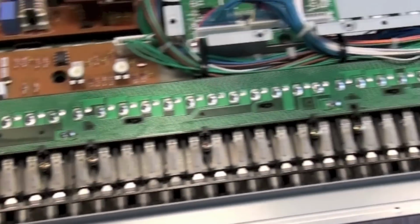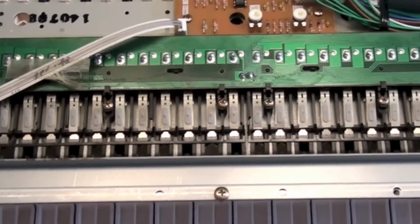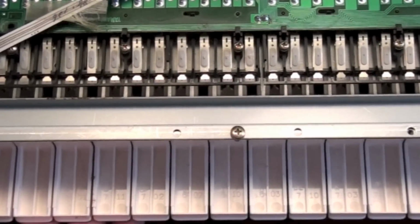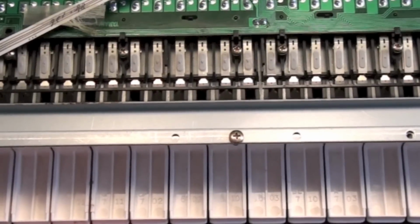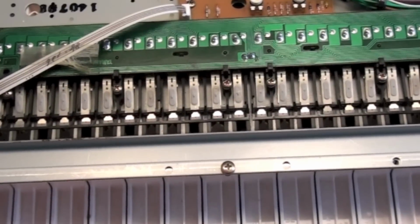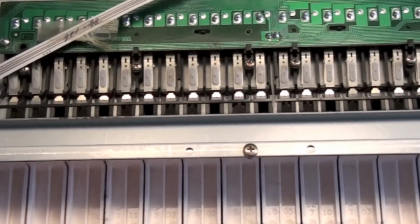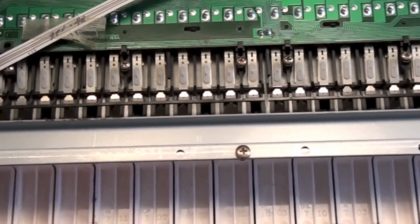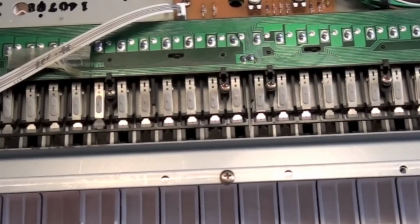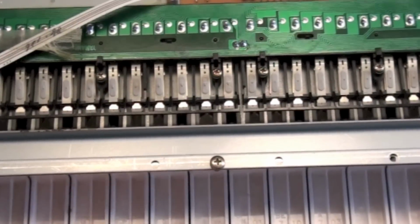There was a fair amount of dust in here, which all I did was blow across this area here. Having first played the key and it wasn't working, blowing and tapping the key, blowing, tapping the key, I could then hear a very, very faint response through the headphones. So I carried on doing that. That's the key that was at fault, and it seems that combination of blowing gently, obviously you don't want any spit, blowing very gently across it, and then suddenly it all came back.